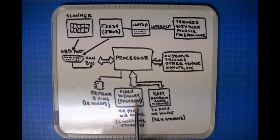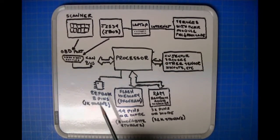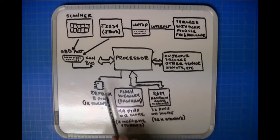So what the engineers do is they'll use a little external memory part, the little EEPROM. And the information in these can be changed 1 byte at a time. So if you have a string, let's say the VIN, which is 17 digits, you've installed a new module, you want to update the VIN, you can program just the VIN. Now, some scanners let you do that. Some scanners will let you write the data to the VIN. Okay, so that covers what these pieces in this module do.